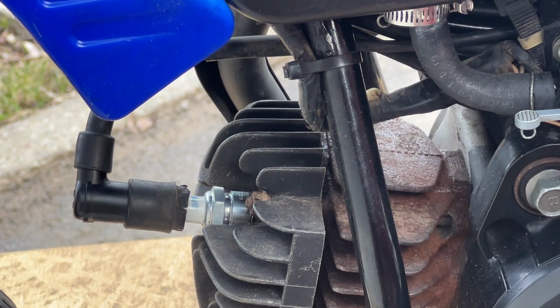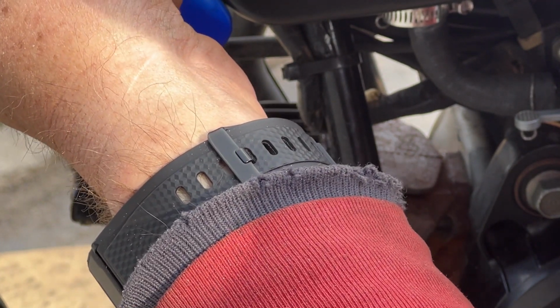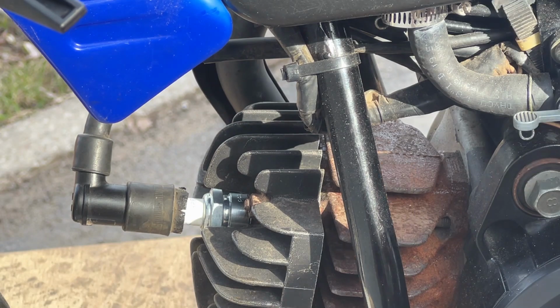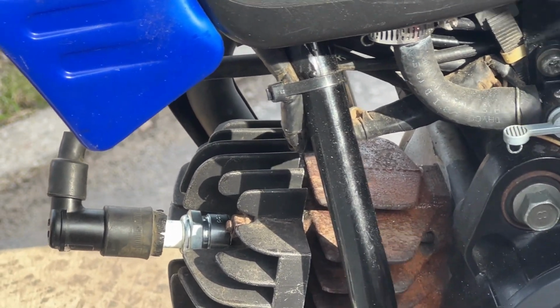Okay, fuel is on. Well, let's kick it again. Let's try and pull. See the choke? There's a mount on the bottom that clips in between this little clip on the frame right here. This is supposed to clip in and pinch, and it doesn't. It screws in, but it's stripped. The bolt is stripped, so it just doesn't grab. Guess that's as much choke as I'm going to get. Let's try that. Whoa. Let's try and not knock this off the table.